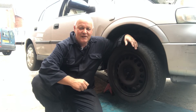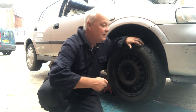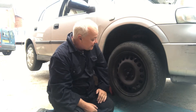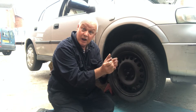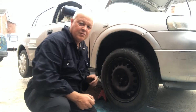Hello and welcome to Rich's Home Mechanics. We're back on the Astra and today we're going to put the front brake pads on it, ready for its MOT in a few weeks time. Safety first - as you can see we've jacked it up and put axle stands underneath. Give the car a quick move to make sure it's not going to come down on you. We've also popped the bonnet open and opened the reservoir cap so when we push the calliper back, any excess liquid will come out onto the rag. Let's crack on and get this wheel off.